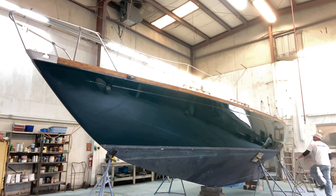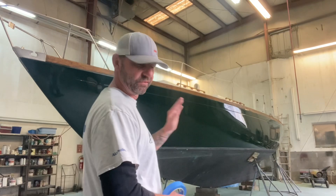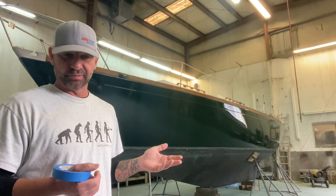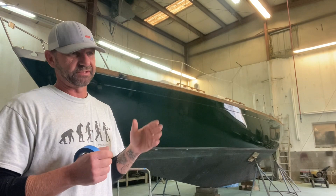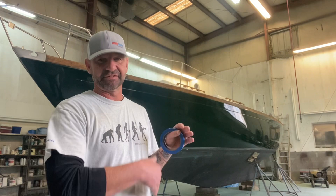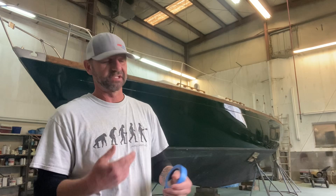All right everybody, I got the gold stripe ticked off with the grease pencil and now I'm going to tape. I'm just using regular old blue painter's tape. I prefer this over the fine line tape because if you pull the tape too tight, it'll get really thin in areas and you end up with a wavy stripe. I always use the blue painter's tape and I compensate for that by going extremely light on the first coat, which seals the tape edge off without allowing any bleed through with the following coating.